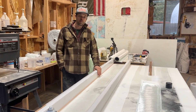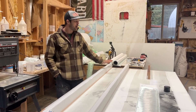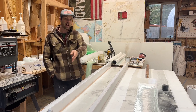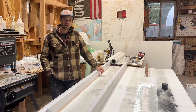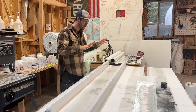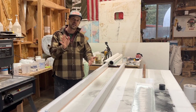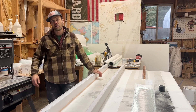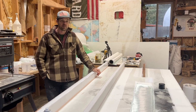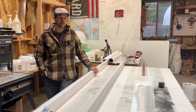I've got the forms built — just 2x4s on the table — with plastic down. I've sprayed mold release wax onto the whole thing and let it dry, then I'm spraying spray adhesive onto it. The spray adhesive is to stick the peel ply onto the form. I'll do peel ply, then fiberglass, then more peel ply on top so I don't have to do as much sanding before I install the flange pieces into the boat.